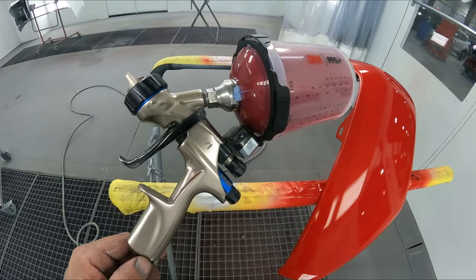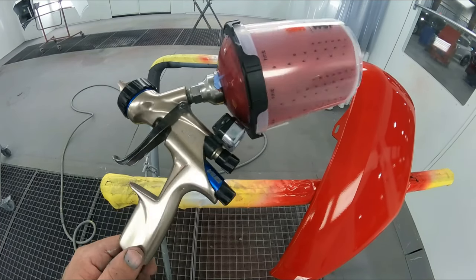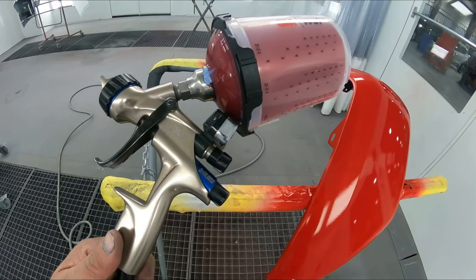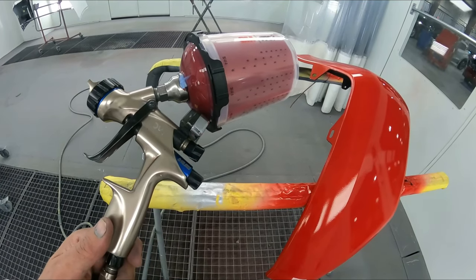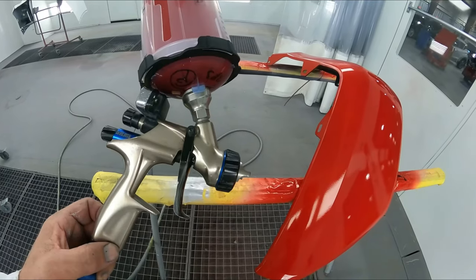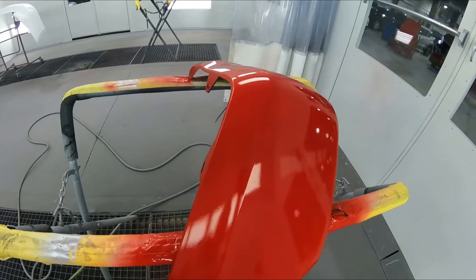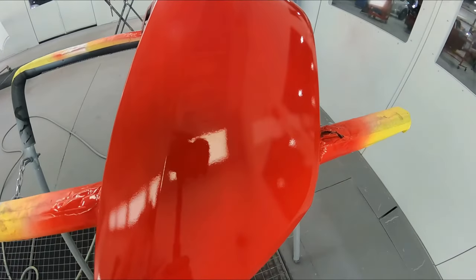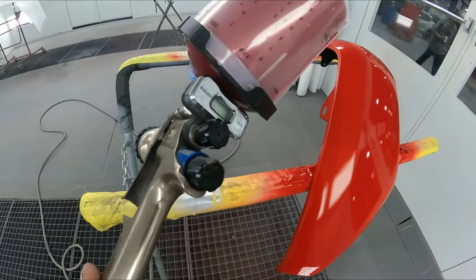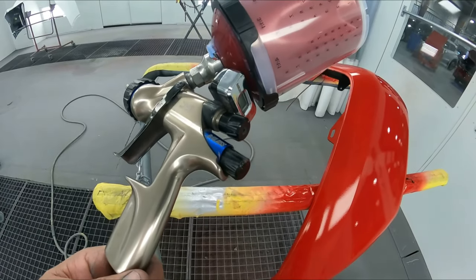These do definitely spray with a better precision coat and it lays it down a little bit less blotchy, but there are ways to work that out with the 3M gun. I'm definitely a fan of the gun and I use it here and there. When I've got something big and I really want to fine tune something - maybe an overall or something - I'll break this thing out. But it's too nice of a gun to get all dirty all day when I can just change out the heads. If you have one and you want to clean it and you don't do as much color changing all day, definitely a great gun. That's the settings I use: 15 PSI, one turn in on the fan with a wide open fluid. Turn the screw until it hits the needle and you're ready to roll.